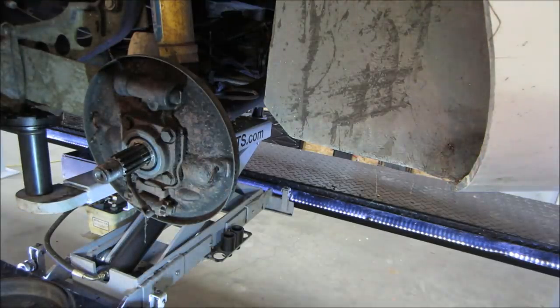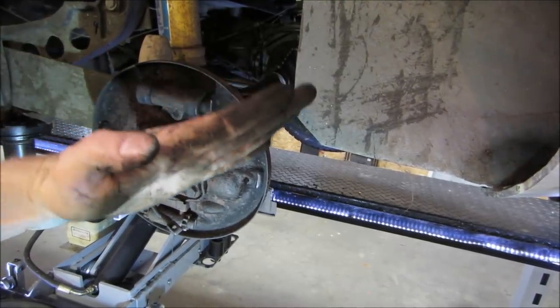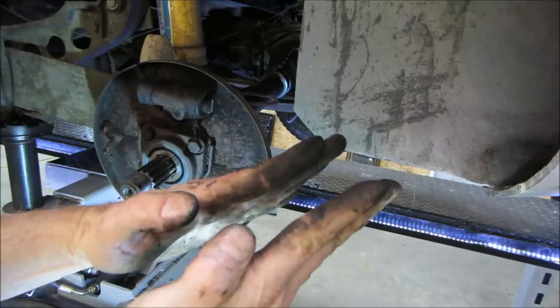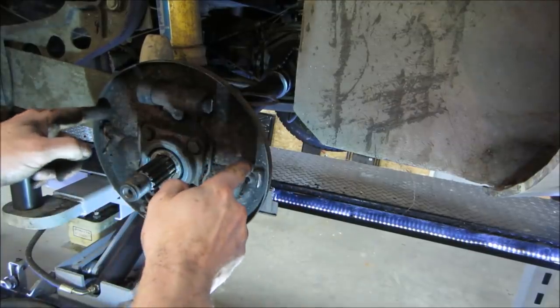Disc brakes don't have that problem, because the disc brake automatically goes to the caliper closes to a certain distance. It doesn't have to back way off every time. It just stays right there next to the pads and pushes, you know, each time just a hair more and just relaxes. Where a brake shoe relaxes the whole distance, whatever the gap is between the shoe and the drum.